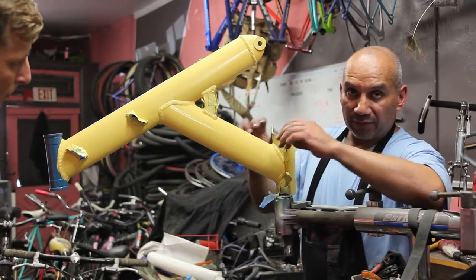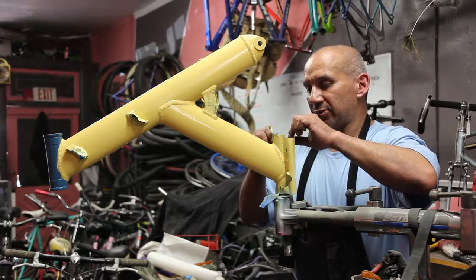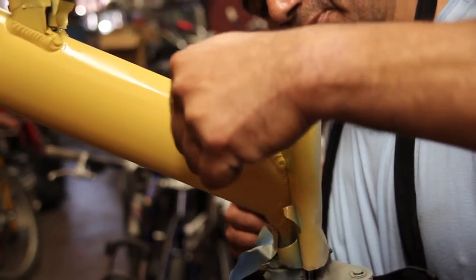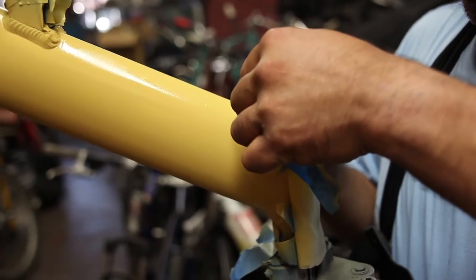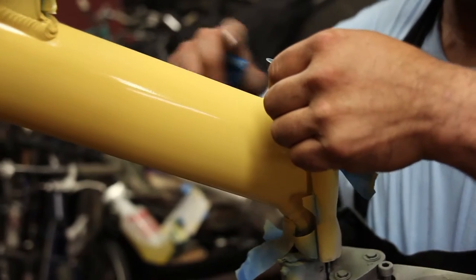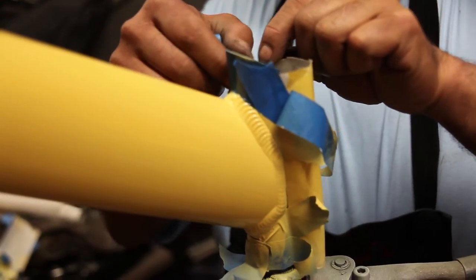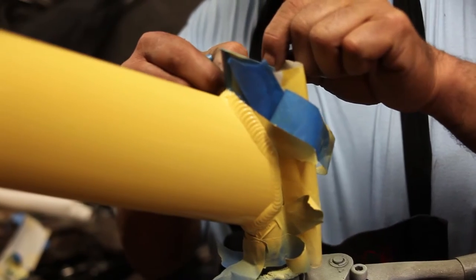These three parts we're going to take off after the paint is fully dry because we don't want to be peeling paint off with the tape. Go lightly as you peel the tape back — if something's really stuck down, you don't want to peel off a whole glob of paint with it. In other forms of masking they do stencils sometimes with flames, tracing patterns with a little perforating wheel and tearing the paper right as it fits the image. We went a little less complex here and just did a quick tape-up.